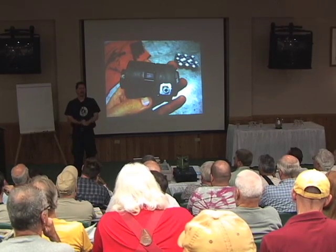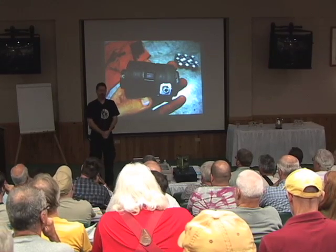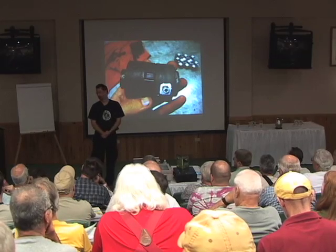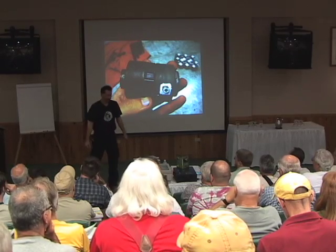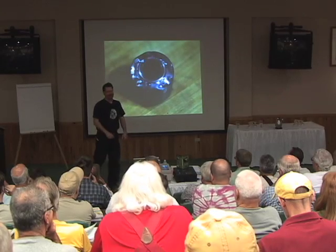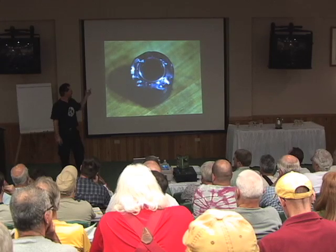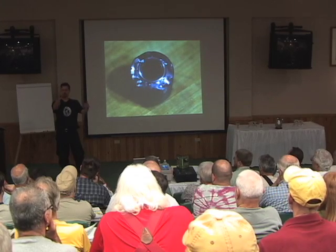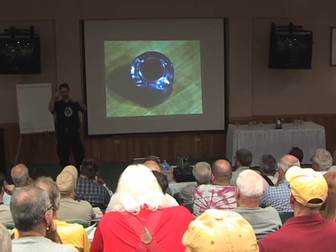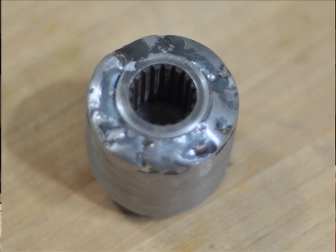...and it stops running. I thought, 'I bet I know what that is.' But by this time I had made a lot of new friends — guys who could weld and machine and were building their own electric cars. One of my new friends said, 'Hey, you don't need that two-part thing. Just take the splines from the clutch disc, weld them both onto a chunk of steel, do it in a lathe so that everything's perfectly aligned.'